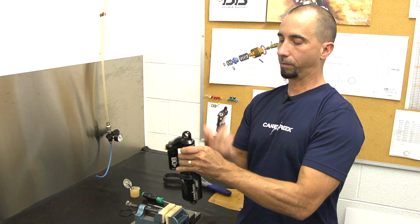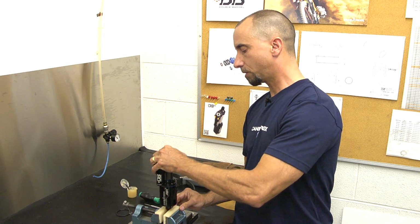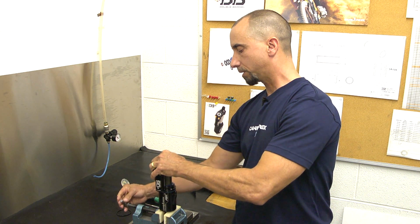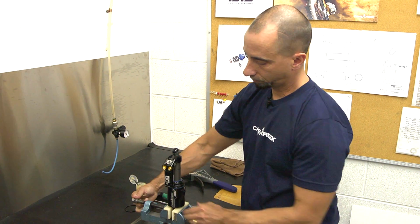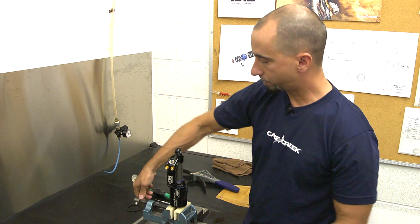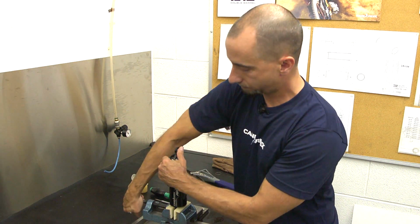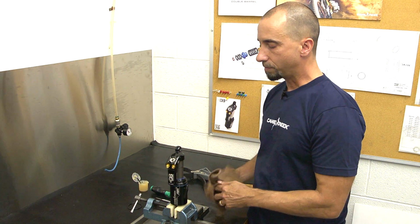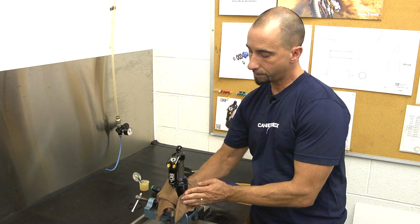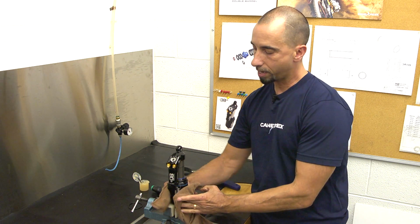And now we're going to pull the air can back up towards the reservoir. This is where your strap wrench is going to come in handy. Tighten it up in the vise. Now you're going to be pulling up, so you want to make sure the vise is tight. You can try two methods here. Since you just re-greased the can, you may be able to just slide this right back on with a rag.